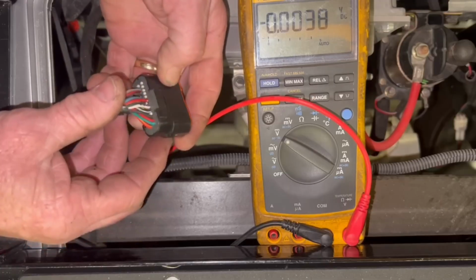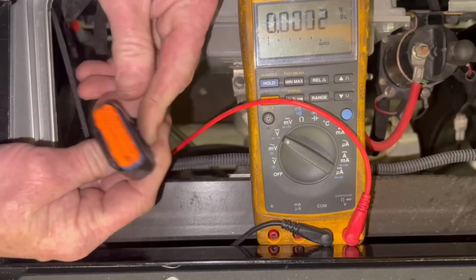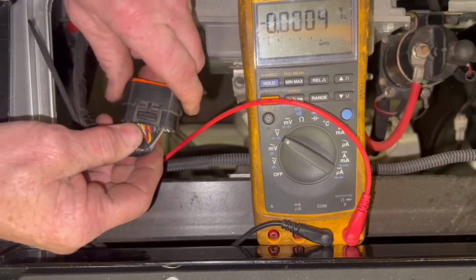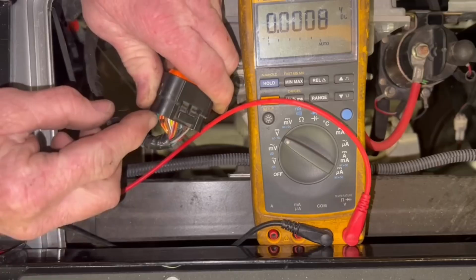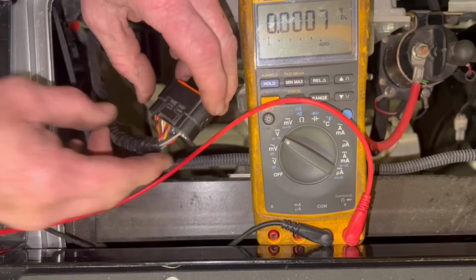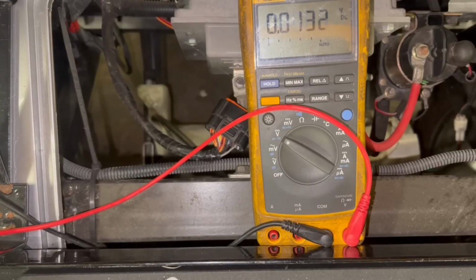right here. Where's it at? Right here, all right. This right here, that's all right, I told you wrong, man. This is the top, so I told you wrong on that. If you look at it, number one's nothing. Number two is your gray pin. I noticed on the video here, man, that I spoke wrong. Number 2 pin, your gray wire, is your hot from your charging plug.